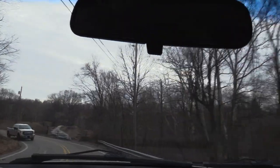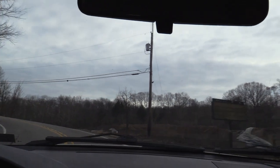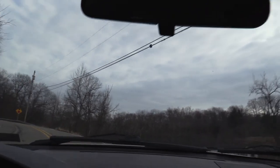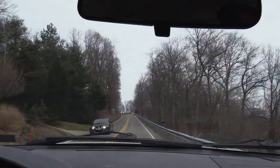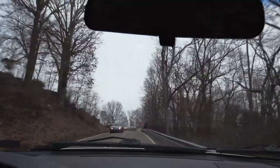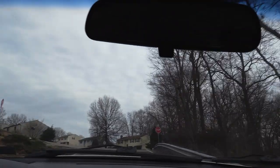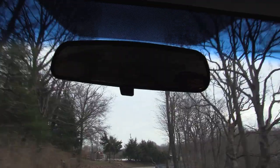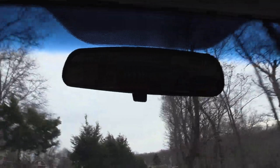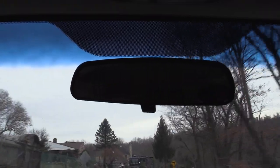There's really not much scan data to be looking at right now, guys. I'm just paying attention to what the car is doing. See if I can get that light throttle surge. Yeah. Kind of, it's there, but the road's bumpy, so it's kind of hard to feel it. That almost feels like a misfire. Light throttle misfire.